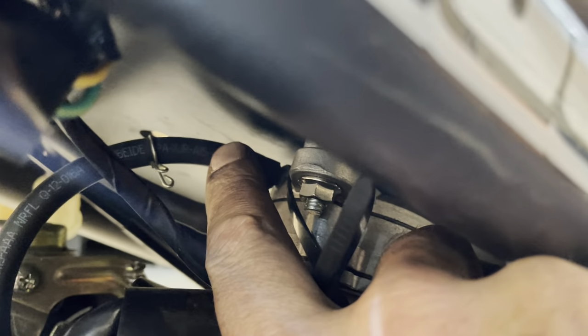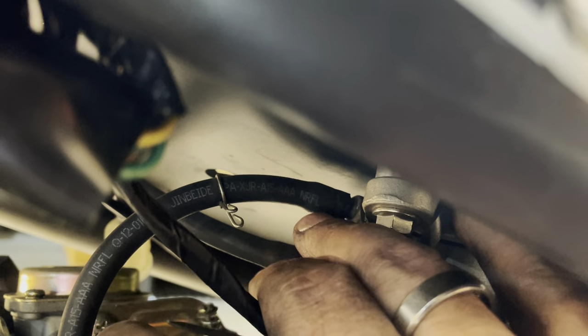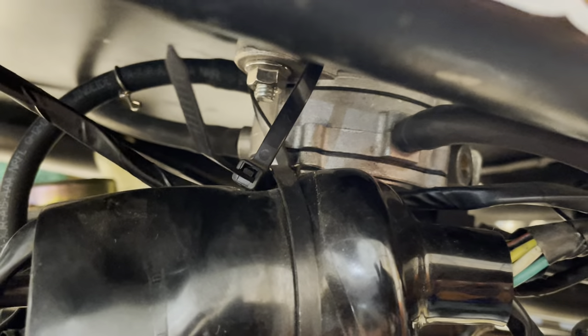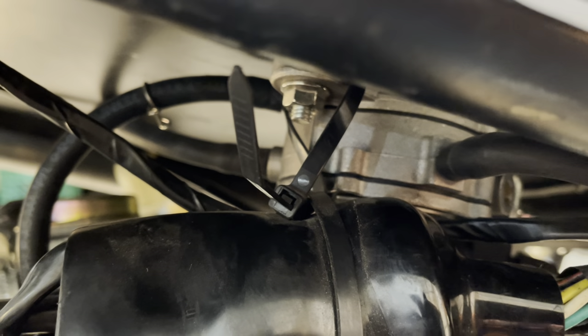That's where it's sending the pump pressure through on this line right here, which goes down to your gas tank, and then that bottom line goes to your carburetor. So if you notice when you're trying to start it, you'll let it roll and roll and it doesn't really do anything. What I want you to do is pump the throttle a bunch of times — it'll help get the gas going. The reason it does that is it creates airflow through the fuel pump, and then fuel can start flowing through.